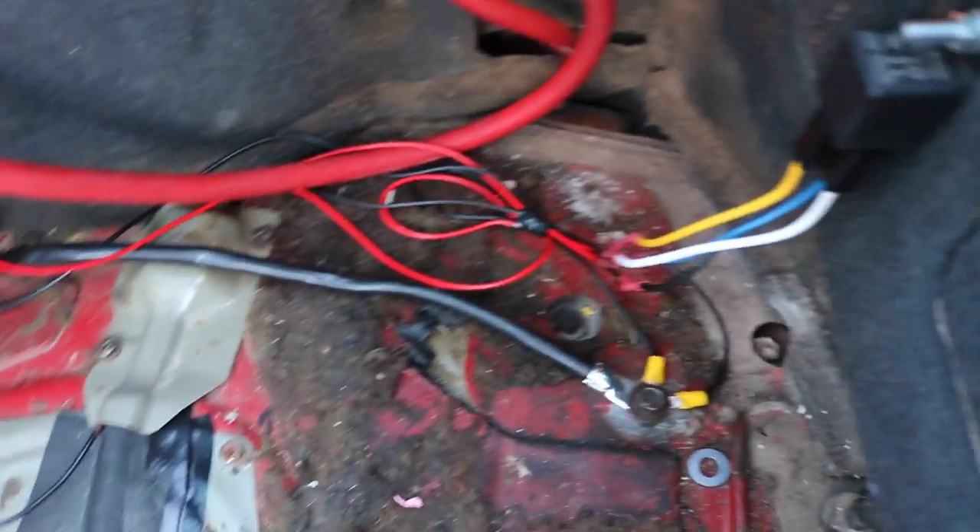I'll find a way to clean this up a little better — but it works, and now I'm pretty excited to take this thing for a little drive to see how the AFRs are going at full boost. If it's still leaning out, that means it's a tuning issue and I'll need to get with Martin to solve that. But if we're getting at least 12 AFRs, that means the hardwiring of the fuel pump has done some of its job. Let's take it for a spin.